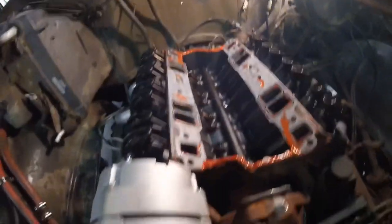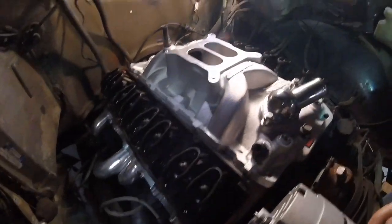I got the intake gaskets on and some RTV along the ends. The excess RTV I just wiped off on the top of the gasket so I didn't waste any. Now I'm going to set the intake down. The intake is fresh on - you'll probably see the holes are all lined up. Everything's lined up, looking all right.